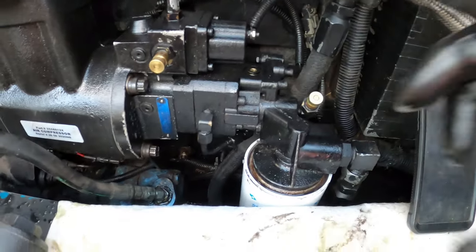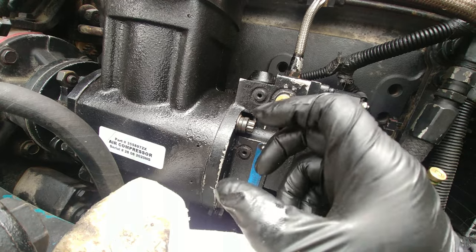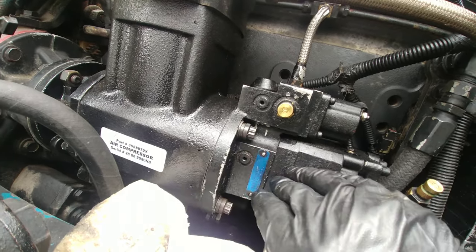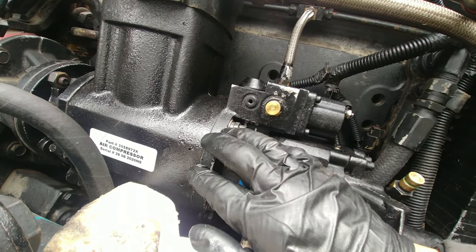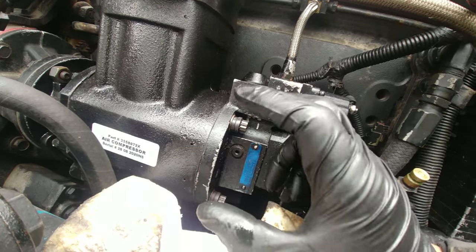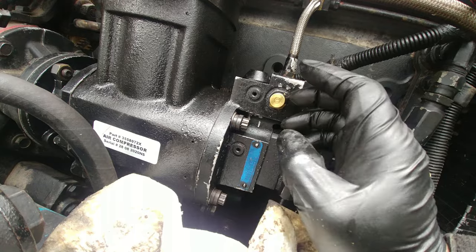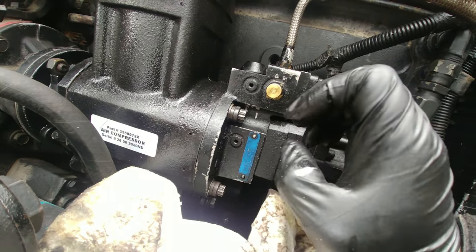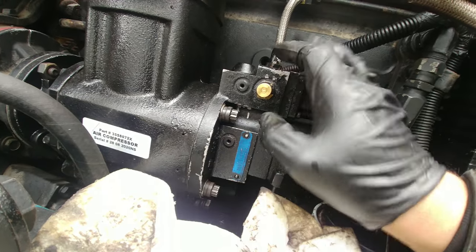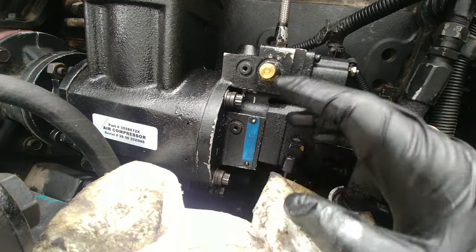Now more about fuel delivery and fuel pressure. There's a spider connection between the air compressor shaft and the fuel injection pump. It works with a plastic insert — like a bushing — in between. Make sure that spider bushing is not damaged, improperly installed, or missing. If it's missing, you won't have a working pump. Remove the four bolts — two here, two in the back — and check if there are any concerns about why you're not getting fuel even when the solenoid is activated.